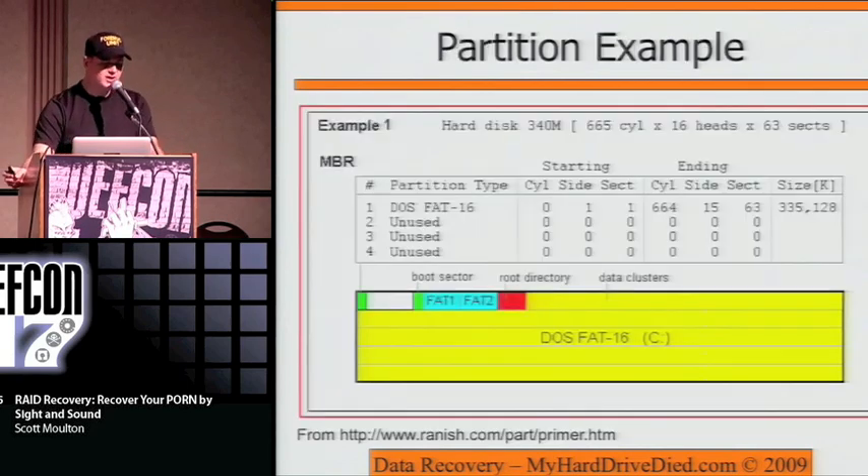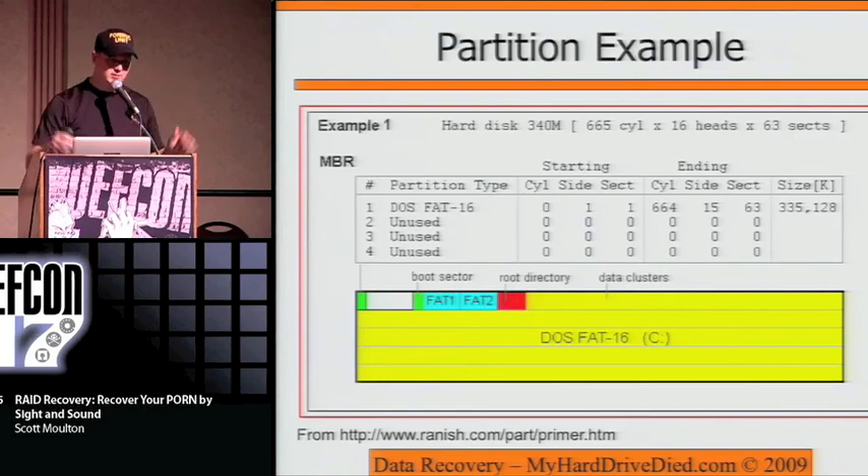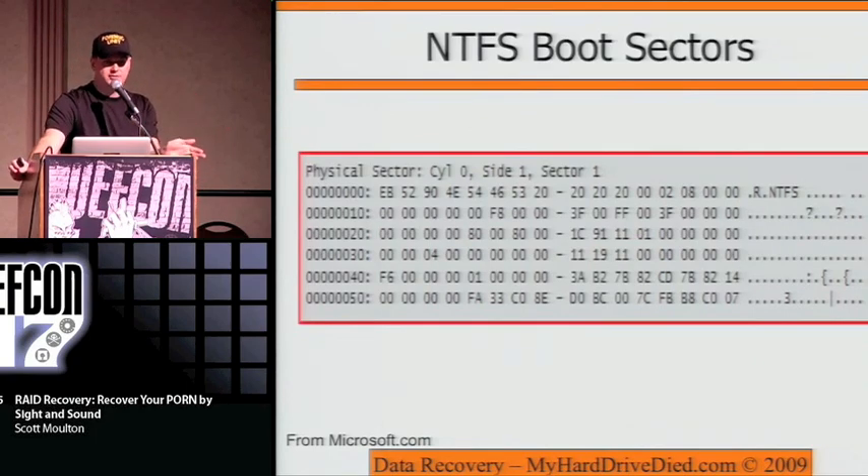You can usually figure out which drive is the first drive. No matter how many drives you have, in most cases you can figure out what the first drive is — it's the rest of the drives that are the problem. Most of the time you're dealing with NTFS or similar. You'll usually have an MBR at the beginning of the disk that says 'I'm number one.' If you're dealing with NT, you'll have an NTFS signature at Sector 63. Most software, once you've repaired the physical side and got it running, will tell you which is the first disk and show you a disk signature.